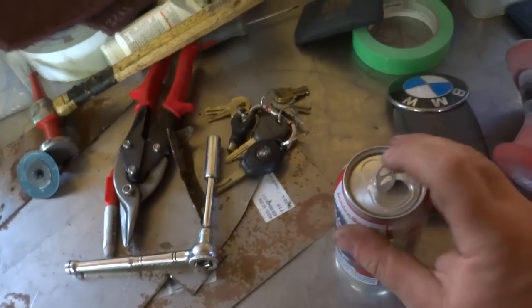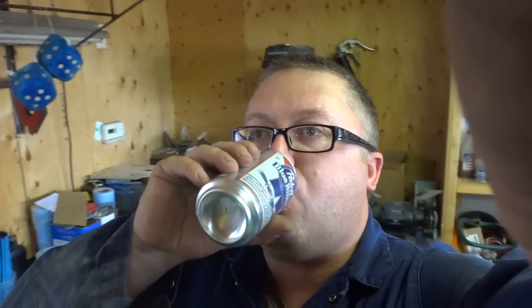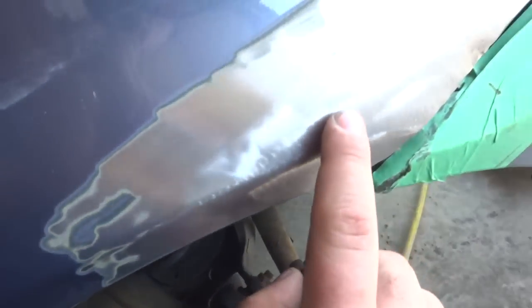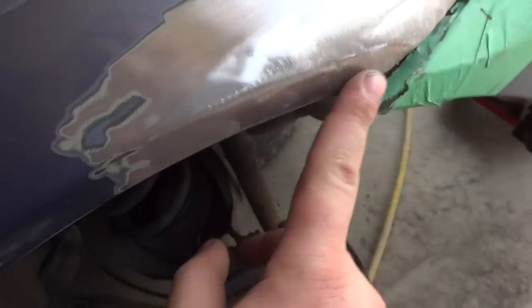I know it's only Wednesday but it's beer time. Being Wednesday and all, I've been on a big push to get the car done as much as I can. I've got Saturday and Sunday to finish it, then lay down primer on Sunday. So — I welded this panel in and it turned out alright. There's a little bit of a dip right in there from the welding, and this little section here didn't line up perfectly, but nothing a little Bondo won't fix.